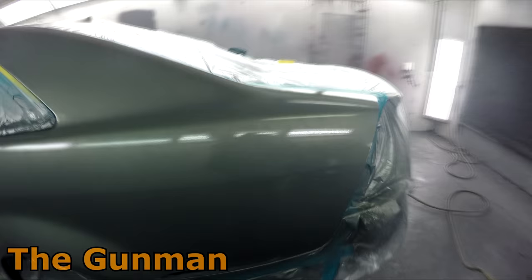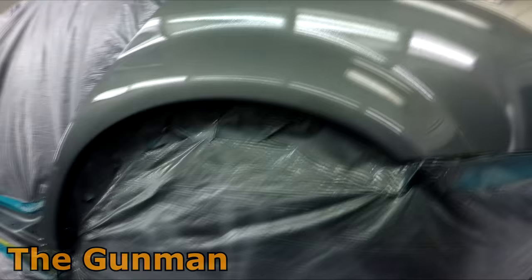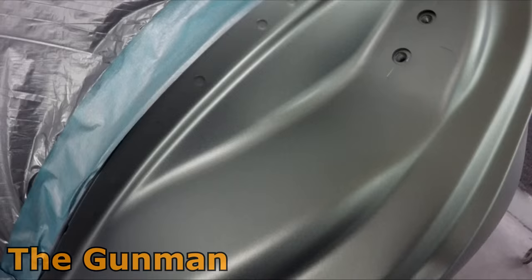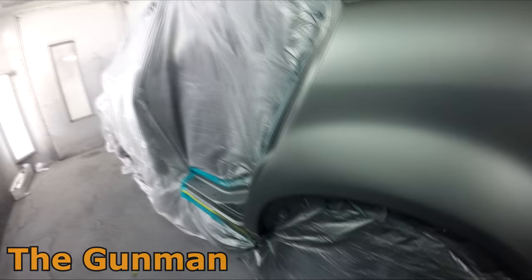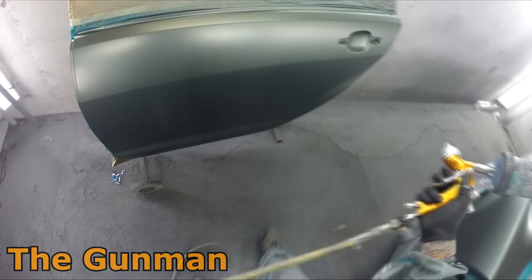Looking at that blend here, it looks absolutely terrible, but that's one thing with waterbase — you get it on and you don't panic. You don't have to get it right the first shot. Through that blend area it looks a bit motley, but it isn't once it's dry. You might notice I put my color right down to the bumper bar because the bumper was already a touch off and my color was actually an improvement from factory. Those spots that aren't dry are mainly because of airflow — the bits the air hasn't been able to flow over are just taking a little bit longer.